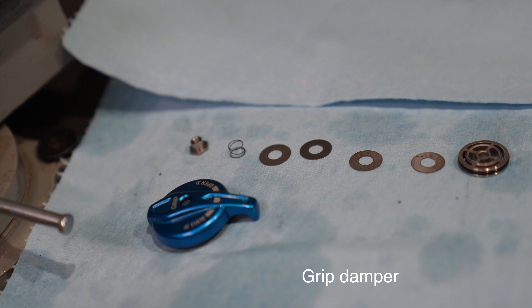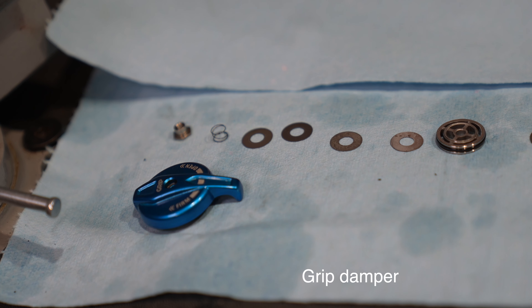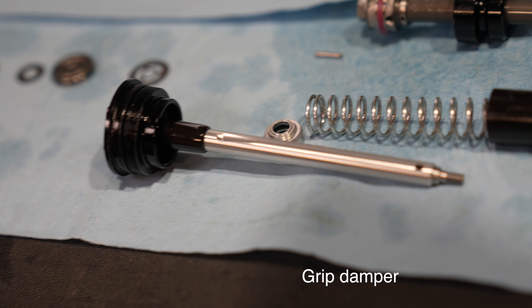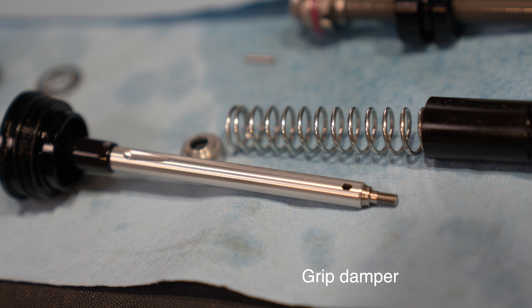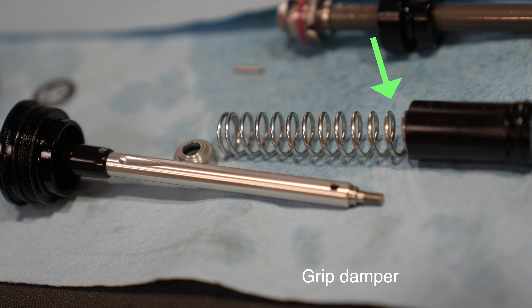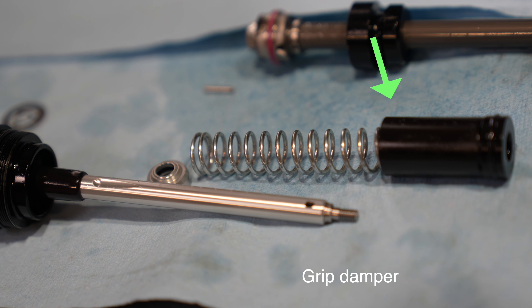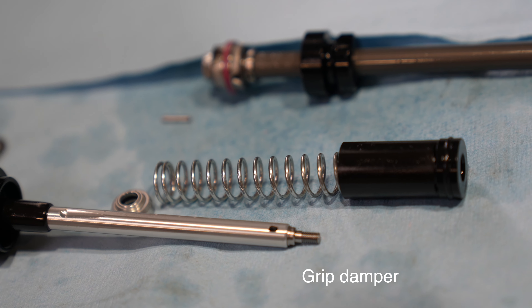Please correct me if I say something wrong — full disclaimer, I don't know everything, I just read this suspension book and I'm trying to learn this stuff. So on the top of your screen is the rail damper fully disassembled. It has a simple compression needle, a nut to hold the base valve on, and then a pretty sophisticated shim stack. The rail damper has excellent mid-stroke support, so I guess we can blame that sophisticated shim stack.